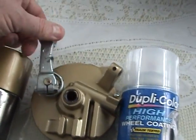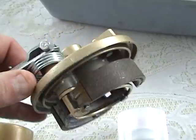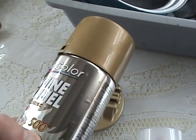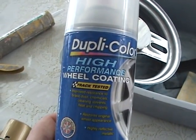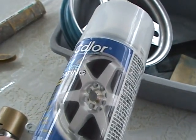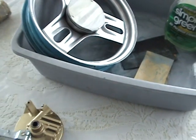Then I'll compare it to the completed brake drum that I've done. I'll have to take all this apart to spray it, and I'll probably give it a good two or three coats of engine enamel — at least two good coats. Then I'll give it two or three coats of high performance clear. I may sand in between to get a good finish. I just want to do it once.